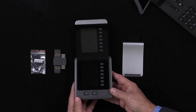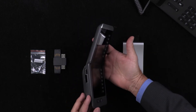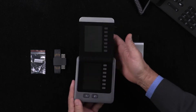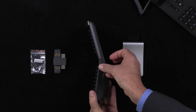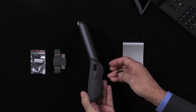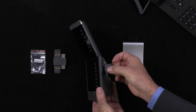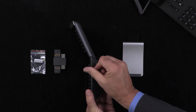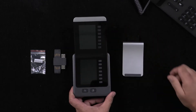Let's have a look at the way the KEM is designed. We've got the connector that will go inside this slot, but as I turn it over I notice we've got some ports here that look like they're for another connector. Some phone models support multiple KEMs, and you would check on the Cisco website or in the TIPPIT guides to see how many KEMs one particular handset can carry.